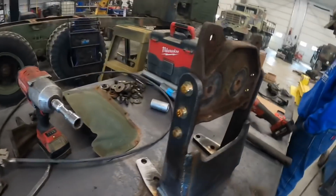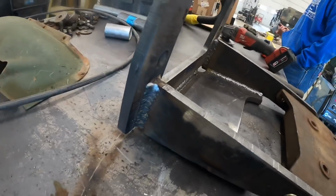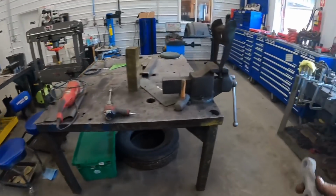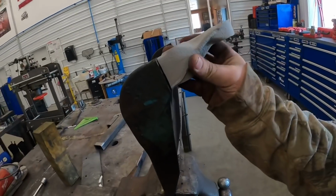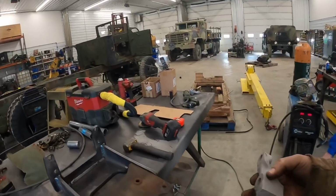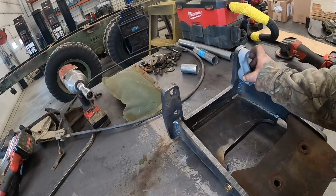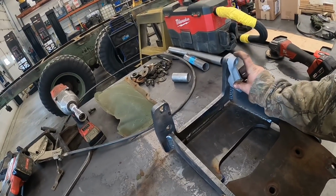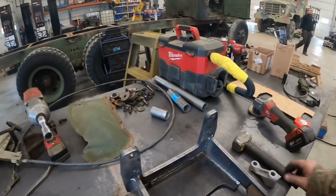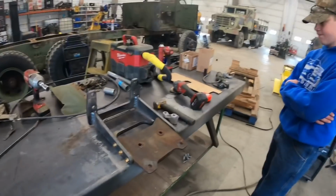All right, we got the motor mount welded up here. It's a little warm. Got her all welded. We do have to add 2 ears, so we cut these ears off of the old original International DT466 mount. Those are on there. Hunter actually bead blasted them. So we're going to put this back in the truck again, get everything bolted up. We're going to bolt these through, and then we'll tack these to a piece we made here. Then we'll pull it back out of the truck and fully weld those, and then the front mount should be done.